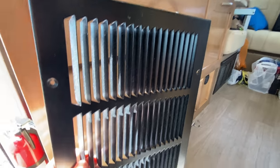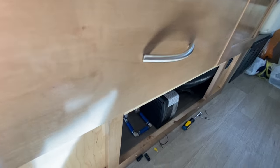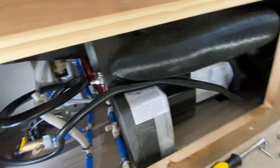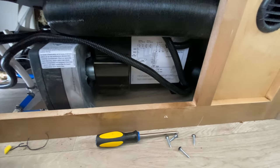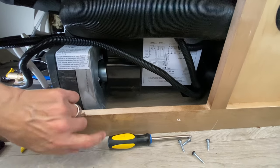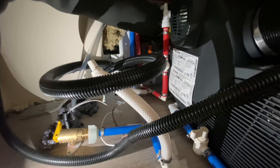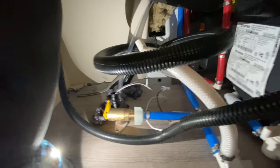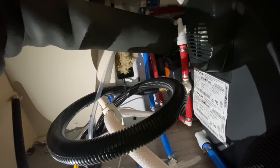In conclusion on the front part of the van, you have to remove the grill from underneath the kitchen — the galley area. To do that you take out four screws. The top screws are easy; the bottom screws are really difficult — you need a lot of pressure or you'll strip them, since they go into hard varnished cabinetry. We came back in here hoping for two simple valves, and it looks like all the valves were shut off properly with the exception of one. That valve is exactly where the leak is below the van.